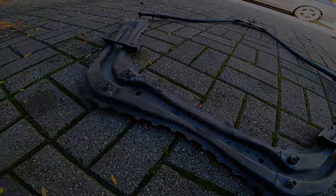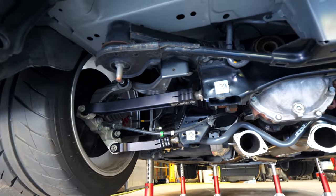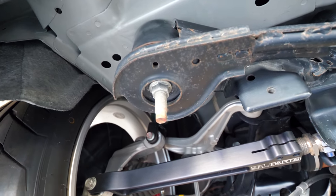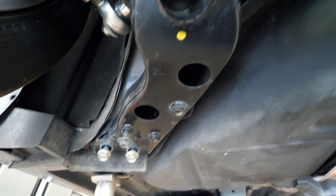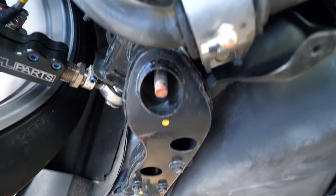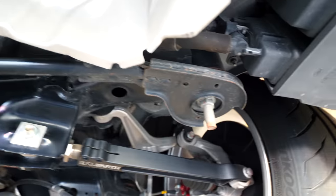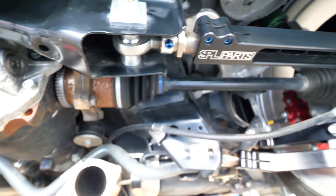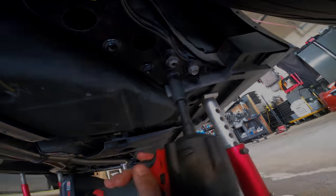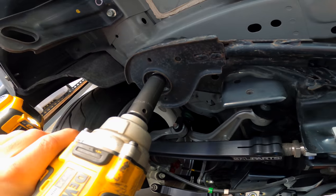With the rear cat-back section and both braces removed, the only bolts securing the rear subframe to the body are: one on each side at the rear section, one at the front section on each side, and the lower brace connected by two bolts and a center nut. Use a 19 millimeter socket for both the front and rear bolts. Loosen the nuts a little bit — just to the bottom side of the thread — lowering it on all four sides so the subframe drops evenly. Then disconnect the front brace attached to the rear subframe by zapping off those two bolts.